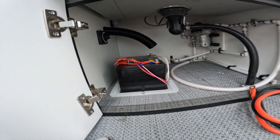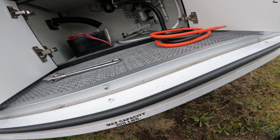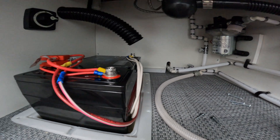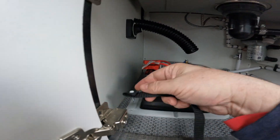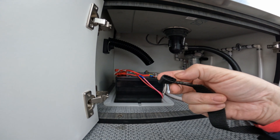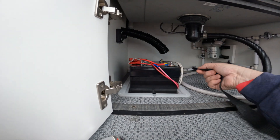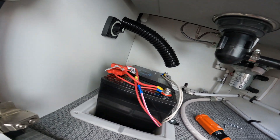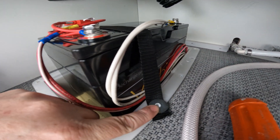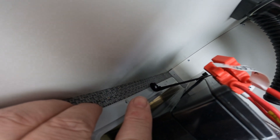I need to secure the battery from bouncing around, so I'm going to use some web strapping and the existing screw system. I took a screw off back there, tripled up the webbing and folded it so there's some strength in the connection, and strapped it diagonally across using the existing screw holes. I put a washer there so it does not pull out. On the other side I tripled up the webbing instead. Step one: secure the battery.